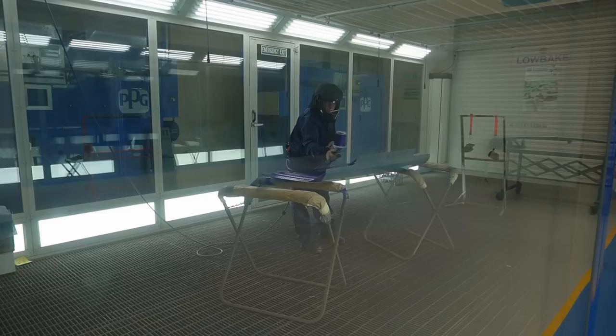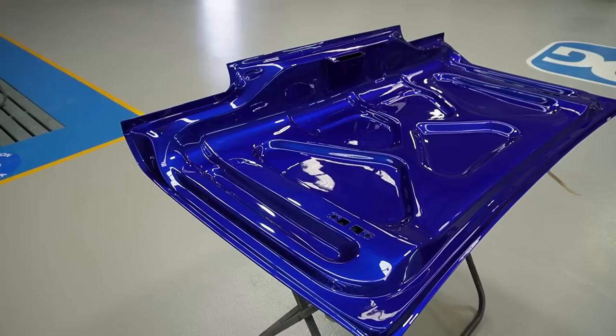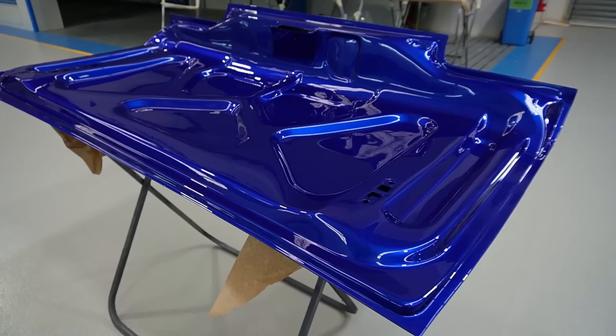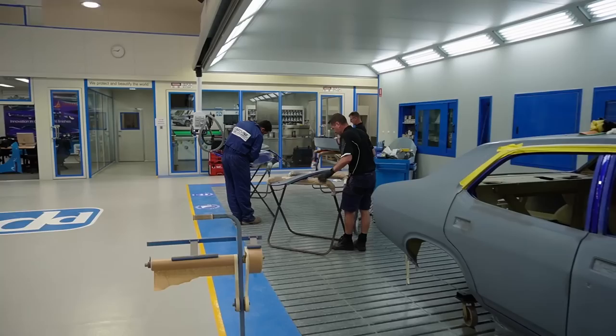So what's the rubbing process that you've used there to get them ready for colour? Just to really get into that fine peel, we've again started with a bit of 240 and finished with some 320. And then we've cleaned them, put some guide coat back on, and then finished them with 400. Where we've rubbed through, we've put a little bit of an aerosol type of epoxy on there, only because we're rubbing through to the primer, not to metal or filler, and that's quite safe to do. And then we'll just run back over that with some 800 and have that ready for paint.